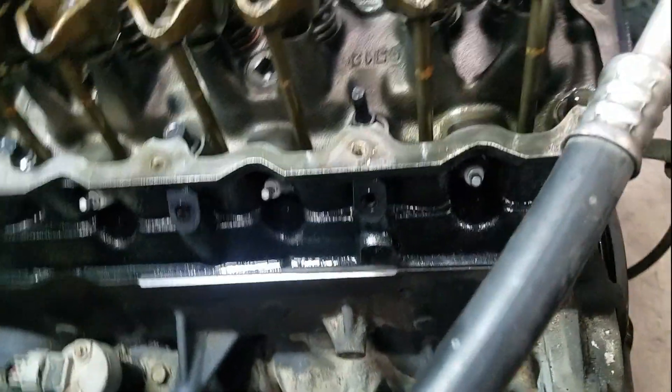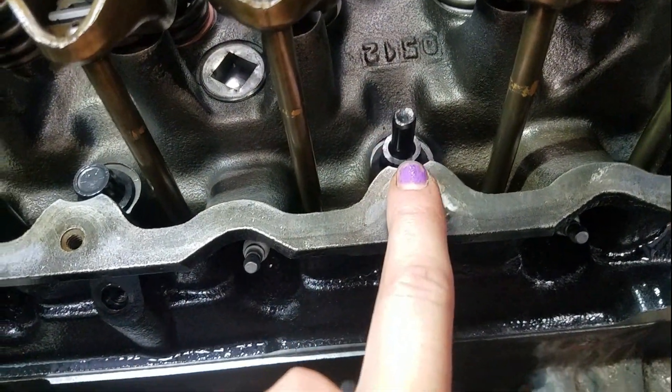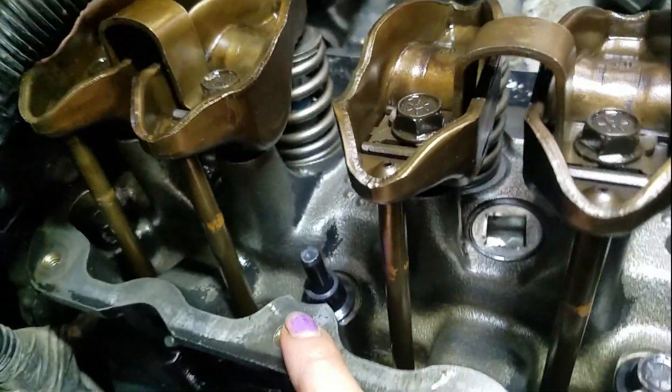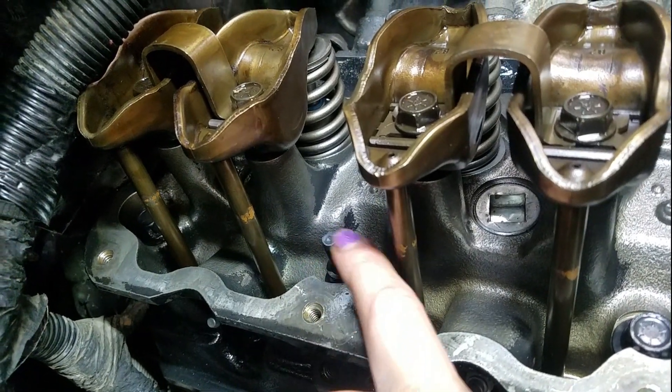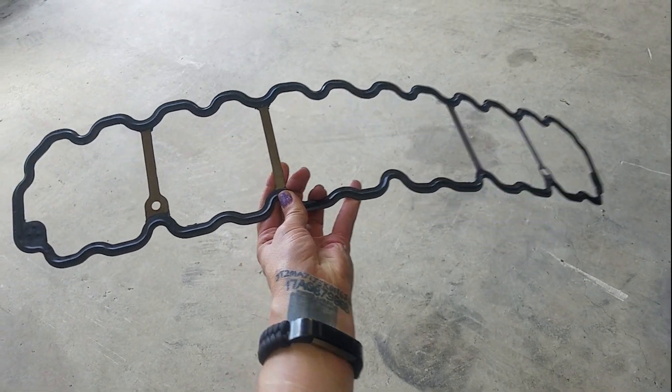So we've got this head bolt — I'm going to move over here. Number two is the head bolt with the little protruding piece there. And then right in the back, the second end: number six is the other one that has that little stem protruding. The reason for that is because these are actually going to help us fit the valve cover gasket into place.